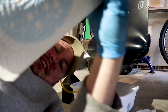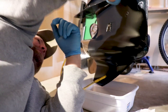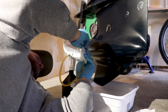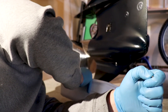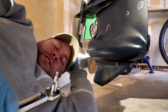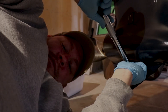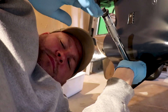Now that it's complete, we're going to take some paper towel and clean up the area before we torque those plugs down. Once everything's cleaned up, I'll move the drain pan out of the way. I'm going to pull out the torque wrench and put the final torque on the vent and drain plugs — the manual says anywhere from 60 to 84 inch pounds. For me, I like to torque mine to about 70 inch pounds, somewhere right there in the middle.